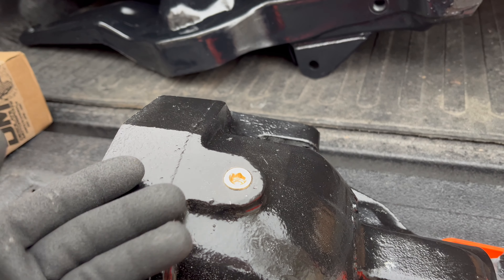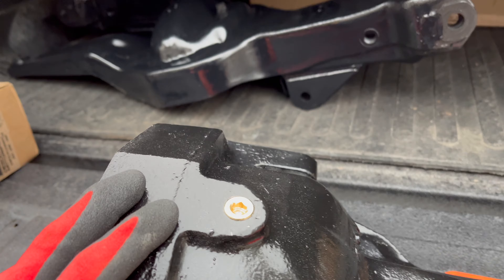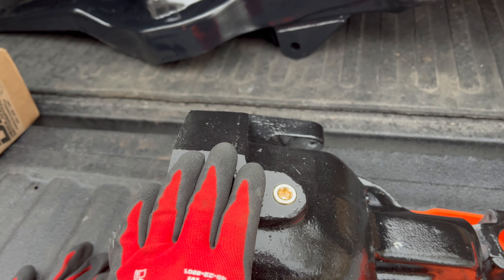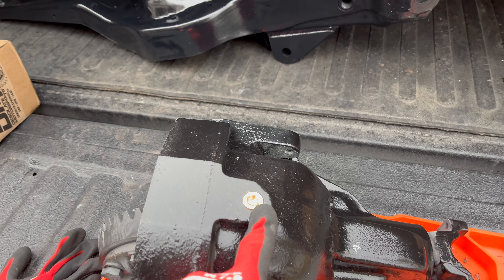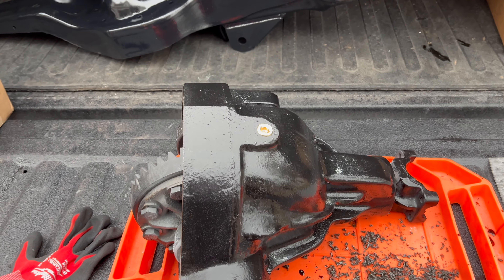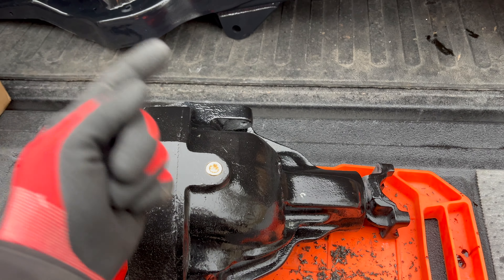I finished tapping for our plug and went ahead and installed it — I'm just super excited to see it. I didn't countersink it, so it sticks up slightly rather than sitting down, because I don't want an area for dirt and grime to build up around the plug and make it impossible to remove. Before you put this back in your truck, use some thread sealant — Teflon tape, pipe dope, or something similar — because gear oil will leak around this plug and you'll have a puddle below your diff. Everything used in the video will be linked in the description.